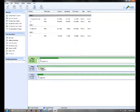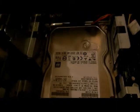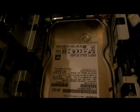And now we have a 1 terabyte hard drive with 4 gigabytes of stuff on it. Kind of an overkill, but this is the reason for the video. Now let's go ahead and move it over to the original Dell. We're going to take the 80GB out of the bracket and put this one in. Okay, I installed the 1 terabyte hard drive.